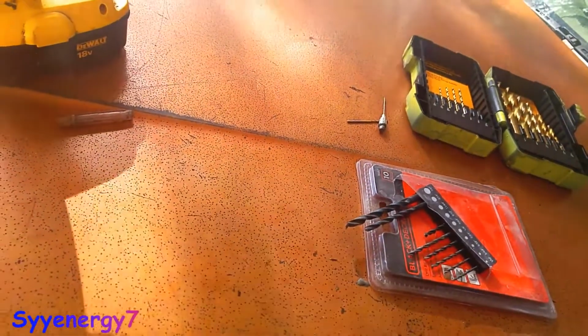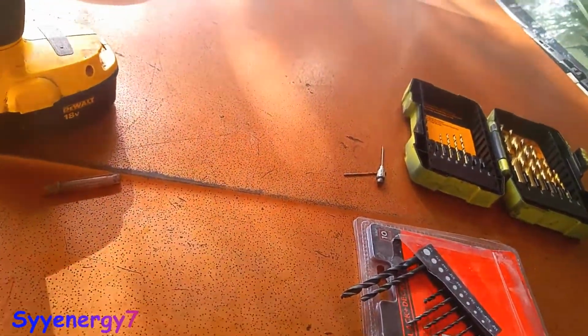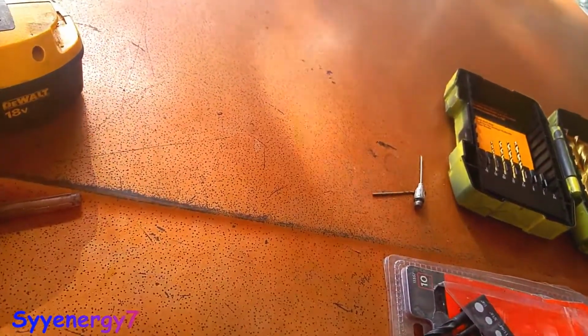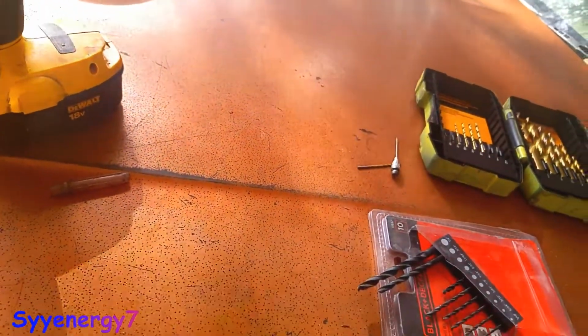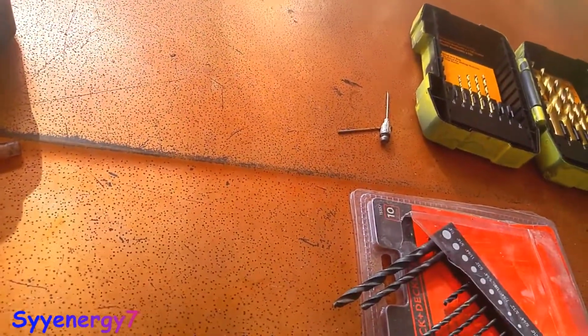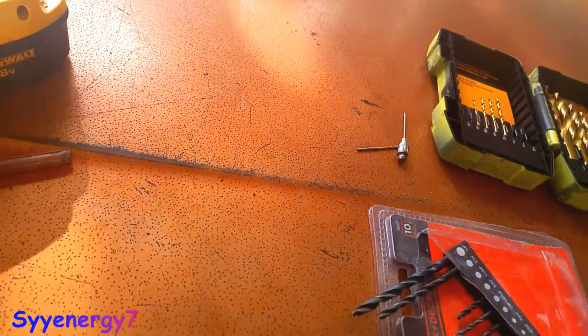If you put a drop of weather strip adhesive over that after you fill it up with grease, it's not going to let any grease out, and it's not going to let any contaminants in. But I'll be able to push through all new grease this way. So that's a cool thing, using your head.